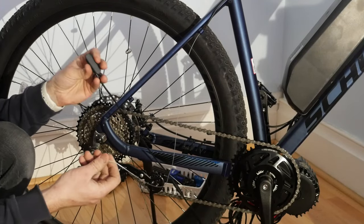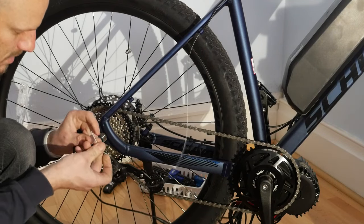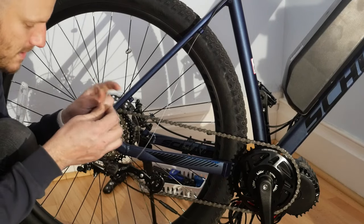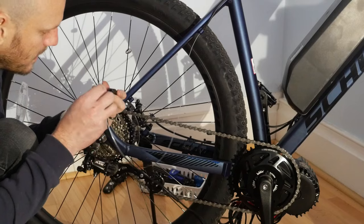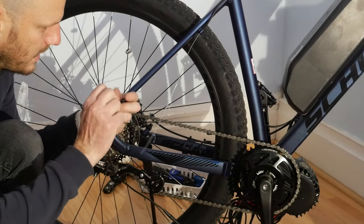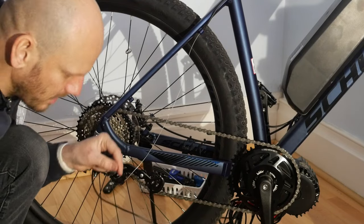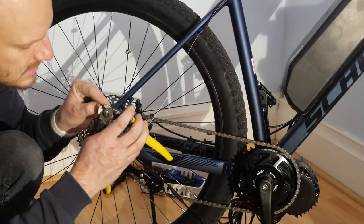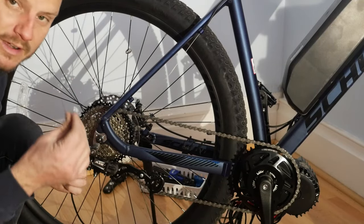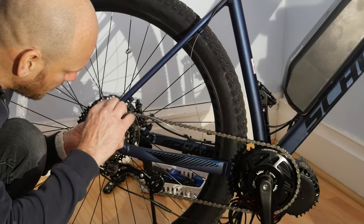Put the ferrule cap on. Feeding the cable through here can be difficult — make sure the ends of your gear cable are not splayed out, otherwise it won't feed through. It's got to be real tight. I like to find the way the cable is spun and just spin it clockwise as you feed it through. Now that I cut it with the cable cutter, it gives a nice clean edge, so I'll feed it through now.